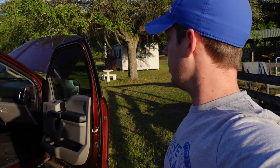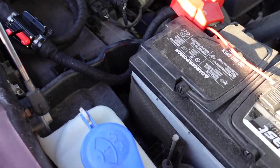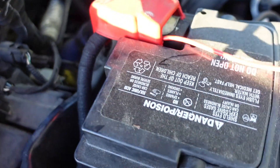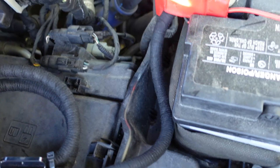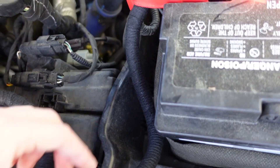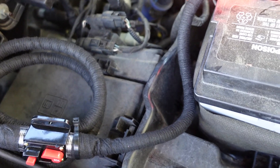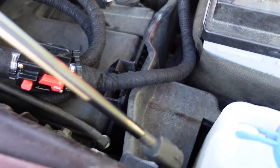So it's already done on the 2016 F-150. Let's go ahead and take a look. We're going to start up here at the battery. We've got the positive terminal there — want to make sure we keep that nice and covered. We've got some split loom, which is just that plastic black stuff you'll see everywhere. You put the wire inside of it, and then we've got that wrapped in some loom tape to help prevent dirt ingress and all kinds of stuff like that. Next up we have a fuse.